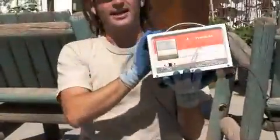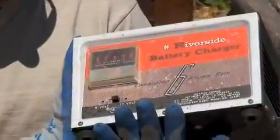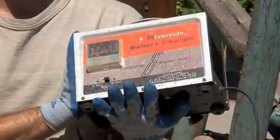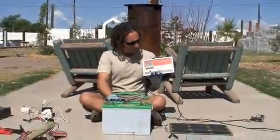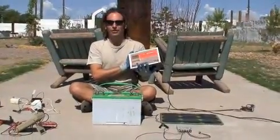There is a third type of charger that I occasionally use: automotive trickle chargers. I like them because they do have some smarts — they back off as the battery gets charged, so at some point they just keep the battery at a small trickle charge and don't keep pushing 8 amps into the battery. These are good for flooded deep cycle batteries, but I don't like them so much for motorcycle and gel batteries — they tend to charge a little too quickly and tend to overcharge.